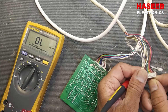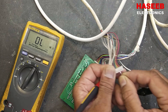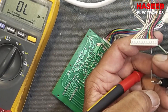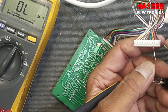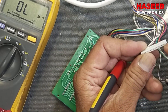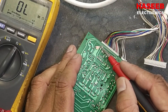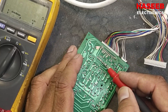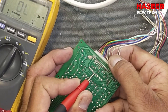Now we will move to the second wire — brown wire, number four. I installed a steel wire, a very small thin size, so that it will enter properly in the connector and not cause damage. Brown wire is here — reading 1.0 ohm, normal. Here 1.1 ohm. In the same way we will move the connector at this point.